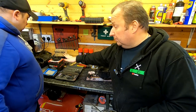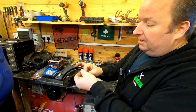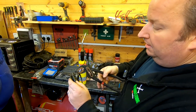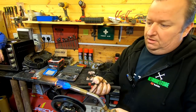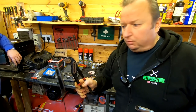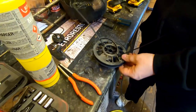We've come to the conclusion that that one's not going to work - the spring's way too big. So I've come up with another idea. What I have tried doing is bending this as it is and it just breaks off. So what I'm going to try is heat this up to take the temper off of it, bend it in place, and then quench it in cold water - hopefully that will re-energise it again. We've just cable-tied the spring in place so it won't jump out. I'm just going to heat this up until it goes red, let that cool down naturally, and when it's cool hopefully I'll be able to bend it into our shape. That's not worked either - so we're back to square one. We really need a spring.